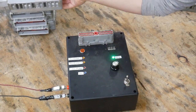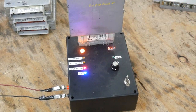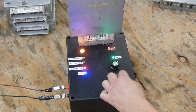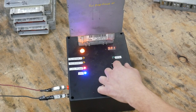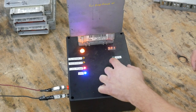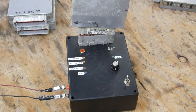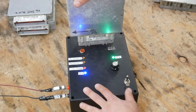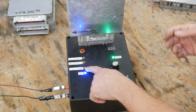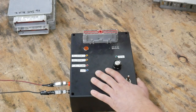Let's go ahead and unplug that. This one's complaint is the fuel pump stays on. So we have a check engine light, which is a problem right away, and we can also see that injector bank is not really pulsing correctly. So this one's definitely got a problem. Some of these you can actually smell have been on fire, or close to it. This one doesn't power up at all — it's just completely dead, and it's got a weak fuel pump signal. The idle air control is decent, but let's try some more.